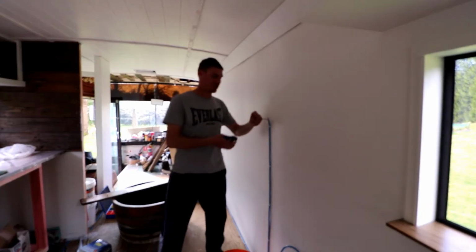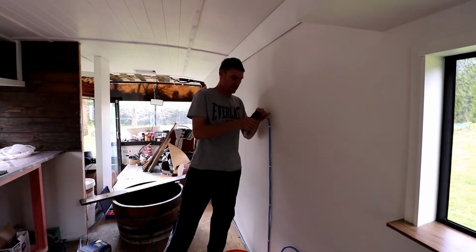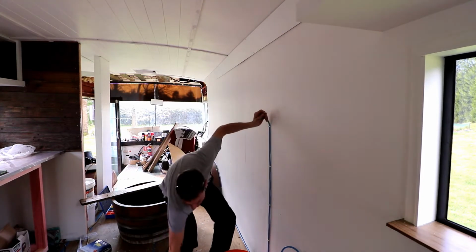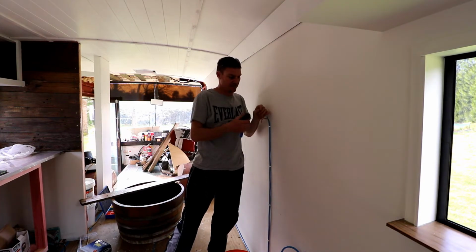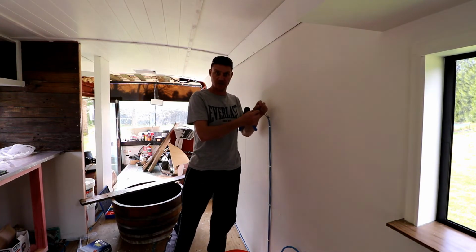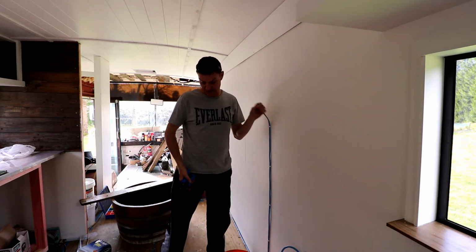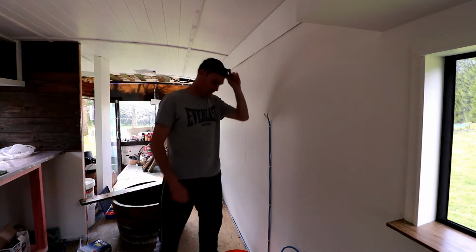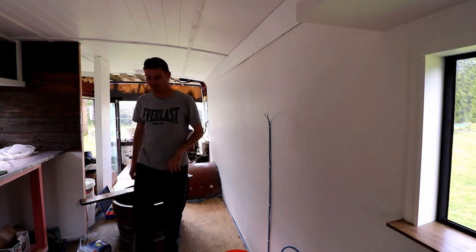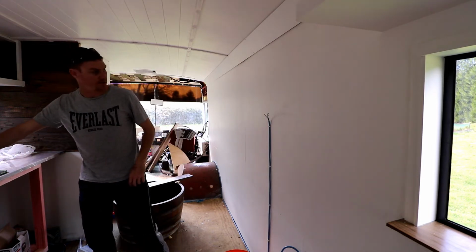So I've just put bootlace terminals on every single flex here, because what will happen is as you screw down the terminals it cuts the flex. So if you put bootlace terminals on your flexible cables, it protects them, and that there I believe is an industry standard. Anyone else that's not doing it that way, well yeah, I've got my opinion on how you do things. I sure as heck don't like to do it that way.